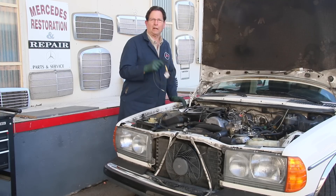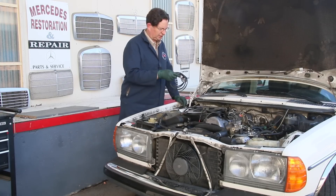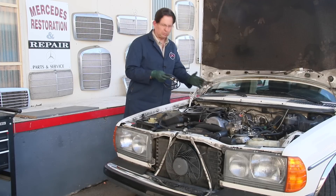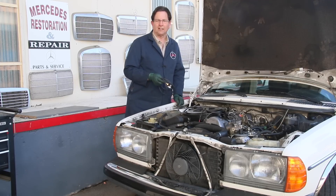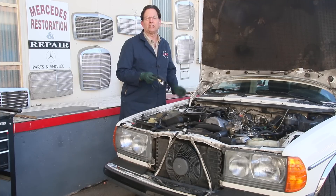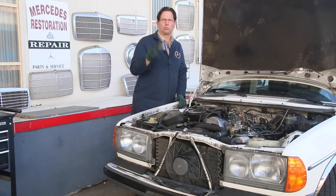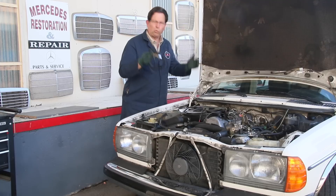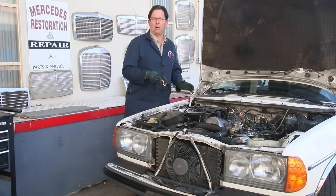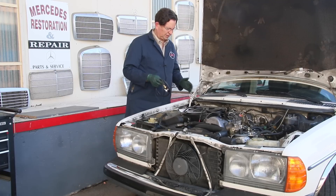It's something you can do very quickly. My kit comes with complete instructions on how to hook this up to your diesel engine, and I also have a manual that takes you through the process of troubleshooting why you're not getting enough boost, including opening up the wastegate and adjusting it internally so you can up the boost pressure. Sometimes if it's real low boost it's just a matter of a worn-out turbocharger, and we do have turbocharger overhaul kits on my website along with instructions so you can take that turbocharger off and rebuild it yourself.